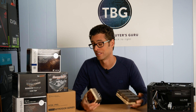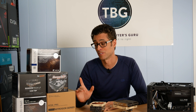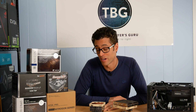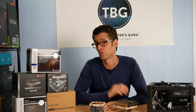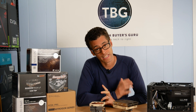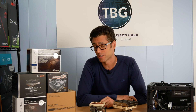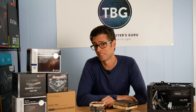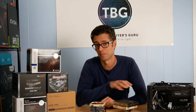I didn't expect this outcome — I had really high hopes for some of the other coolers. In terms of style, the Scythe Big Shuriken 3 would have won; I love the look of it, but it didn't have the performance to match. I also thought the Be Quiet cooler had a good combination of a nice heat sink and thick 25 millimeter fan; it was in the middle of the pack — a good compromise, but given it's only a couple dollars less I couldn't name it even a runner-up. The Silverstone cooler brings great performance but is an outdated design, hard to mount, and extraordinarily loud — I'm not sure anyone should be buying it now that we have superior coolers.